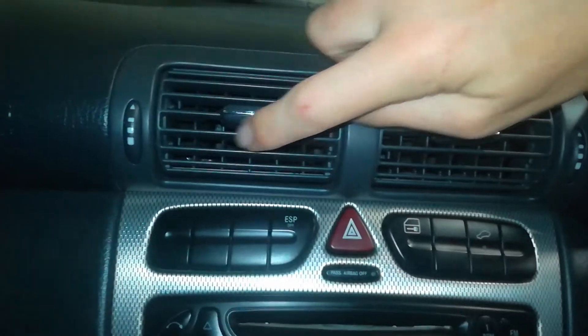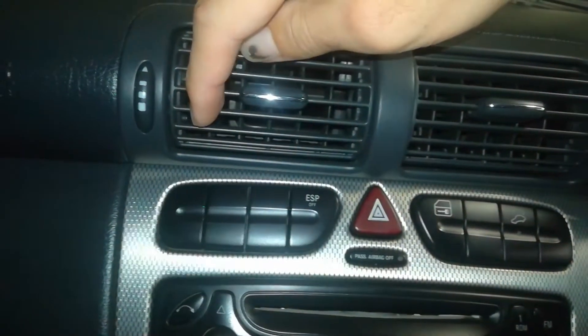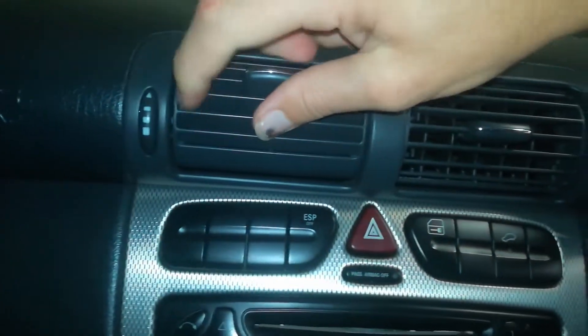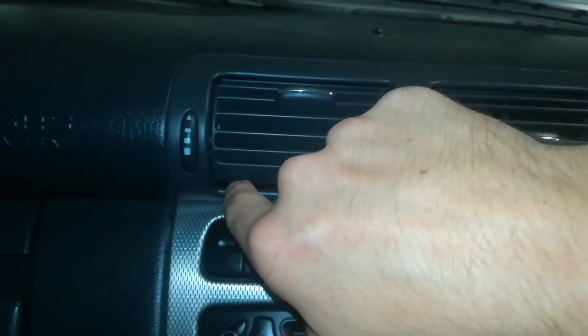There's a spline over there and for that you have to tilt this — there's a little tab in there. You literally have to push that tab outwards and tilt this backwards. As soon as you tilt it backwards and up, the whole thing twists to the back and you can slide that torque split piece right through there.